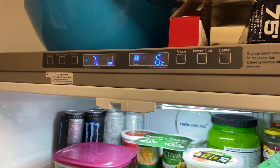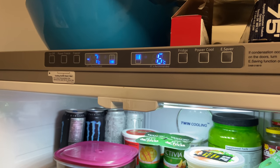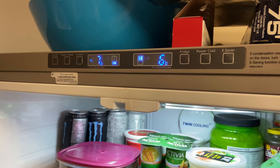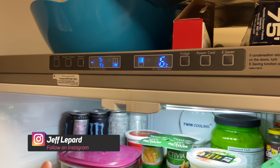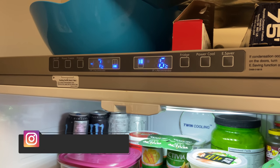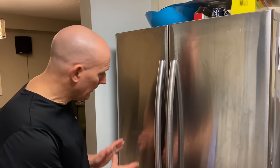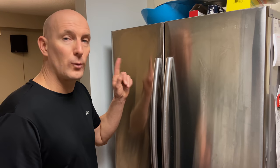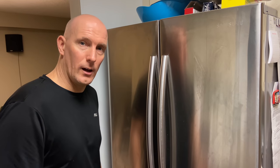What this means is that it's keeping the heating elements on and it's not actually cooling or freezing your fridge — your heating elements are on for the fridge and the freezer. It'll cycle for 30 minutes, continuously beep, and then enter back into fridge and freezer mode. If you have a model with a dispenser, to activate power defrost you're going to use the Freezer top-left and the Lighting middle-right buttons.